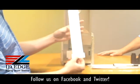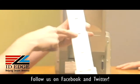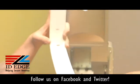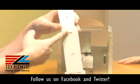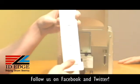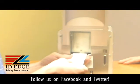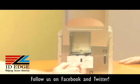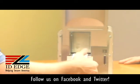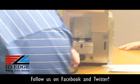These rollers here might be a little hard to see on camera, but they look more brown than black. That brown color indicates the rollers actually have dirt on them. The black marks mean the rollers are clean — that's just rubber leaving residue on the cleaning card. If you notice a lot of the rollers are still brown, you can flip the card over, push the little black button again, and it will run another cleaning cycle. Then it will eject and the rollers will be much cleaner.